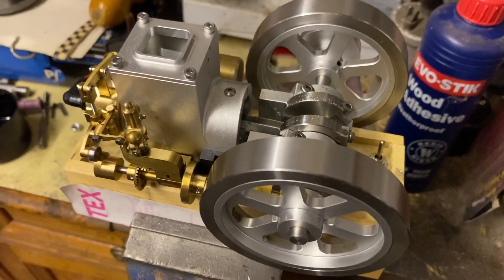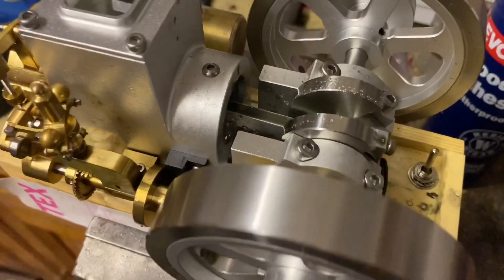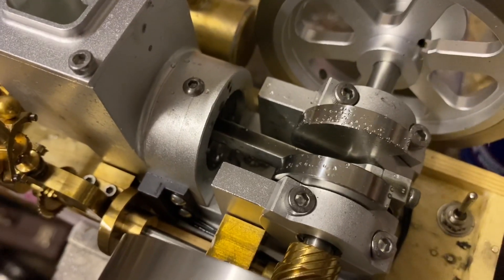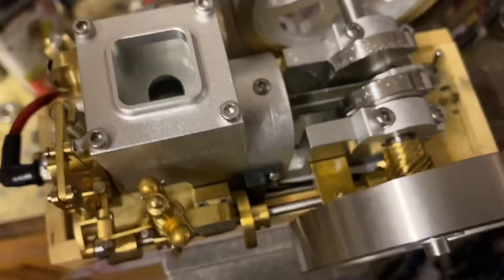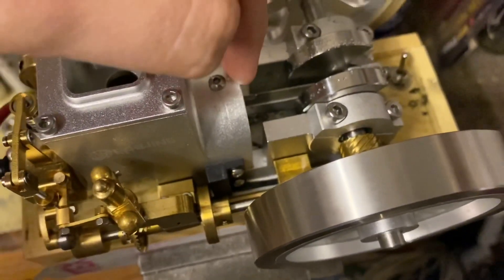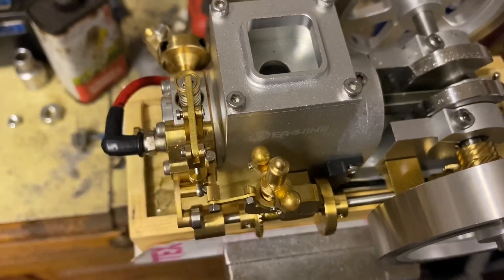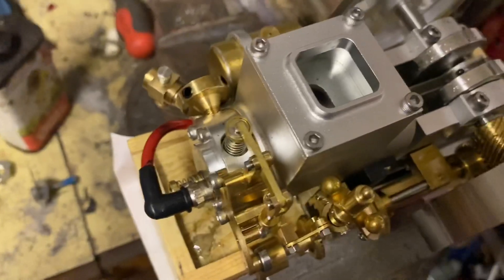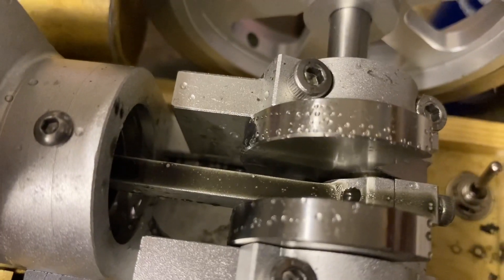There you go — that's the first little run of this ET6 engine. I don't know how many other people have had slightly issues with them, but my one's definitely got a problem. You can tell down here by all the water that it's definitely got a water jacket leak. So obviously there's some sort of seal issue. This is a barrel that you can remove — I'm guessing this little Allen screw here can be taken out and this entire sleeve can be removed along with the piston, probably through the front of the engine. So it probably just needs a seal or some silicone sealant on it to stop it from leaking, because it's definitely got a problem with water being passed into the cylinder.